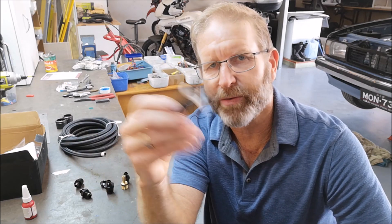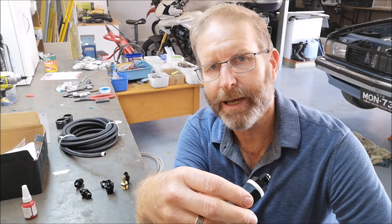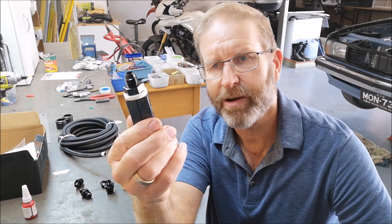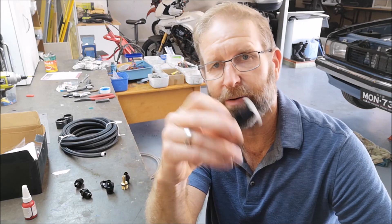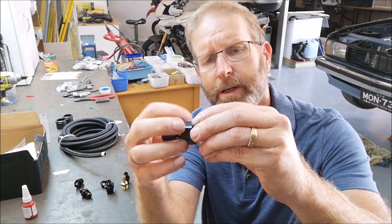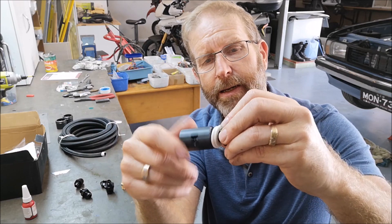This one is the actual bonus. For your fuel system, if you put a tank like this in, you've got to have some sort of airflow. This is what's known as a rollover valve - if you roll over, it actually shuts off, but it sits open all the time letting air come in as you're sucking fuel out. You need to replace that volume with air, otherwise you won't get any fuel draining from your tank. It'll pop out somewhere off the top of the tank, probably come out at the bottom of the boot. It has the ability to bolt in, so I'll put a hole in the boot, slip that through, and screw it on.